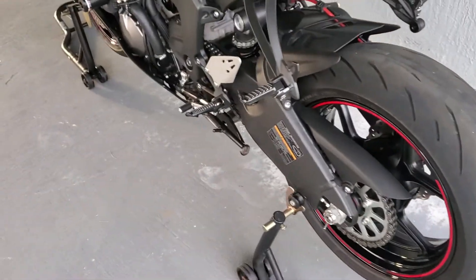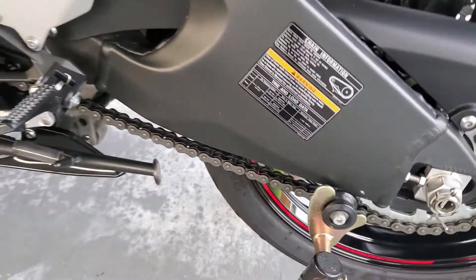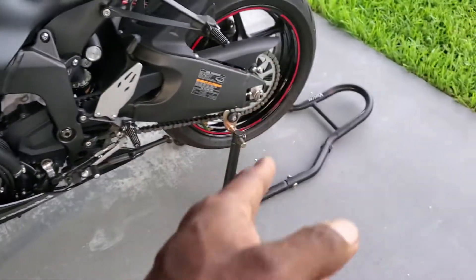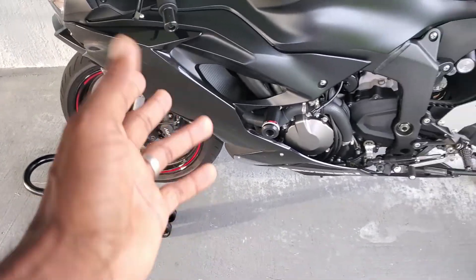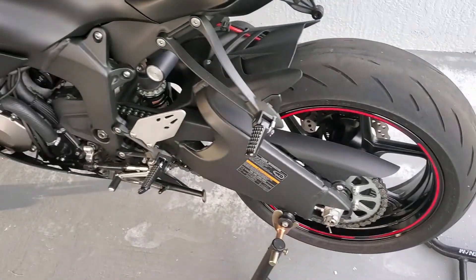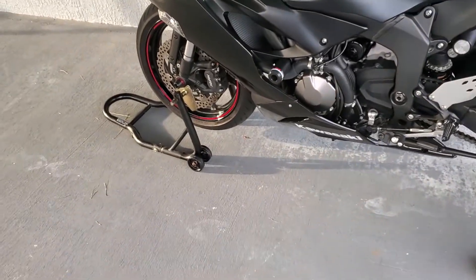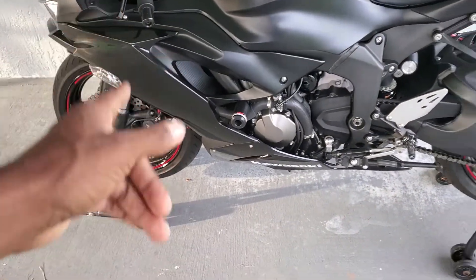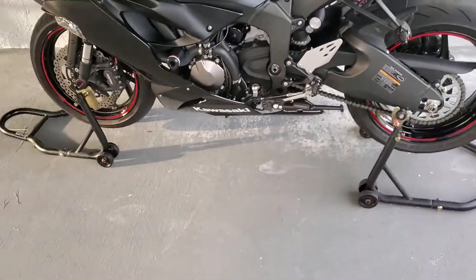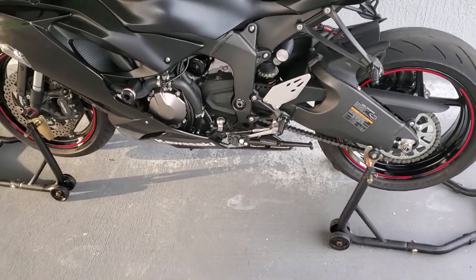The struggle I've had since getting into sport bike riding is figuring out how much tire pressure the bike should have. Some people say follow the recommended pressure on the side of the bike, which is 36/42. Others say follow the manual — same thing, 36/42. The website for these specific tires also says 36/42. But not all riders weigh the same, ride the same, or ride in the same temperature conditions. So with this new set of tires, I'm going to start off at 34/38 and see if I like the ride, since I ride aggressively in a state that's primarily hot.